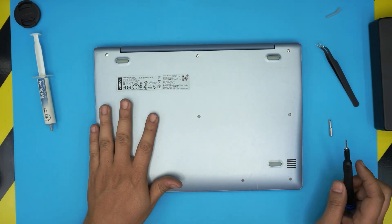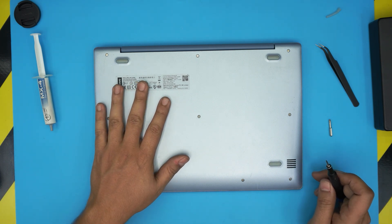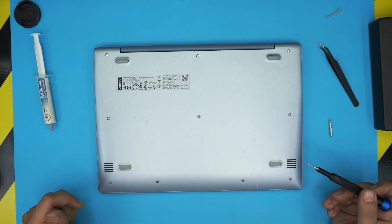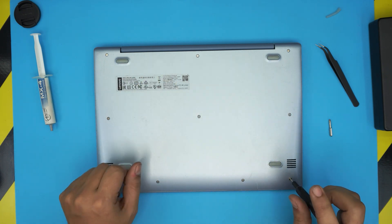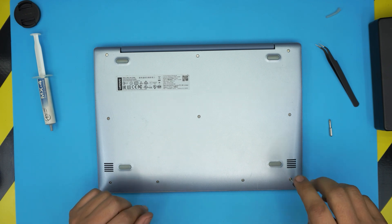With all the tools on hand, we're going to start opening it up. First thing: make sure the laptop is powered off completely. On the bottom you're going to see a bunch of screws — there are no hidden screws. All screws are the same size and height, so don't worry about mismatching them. Go ahead and remove all of them and keep them in one pile.